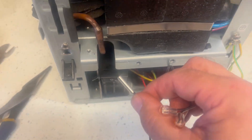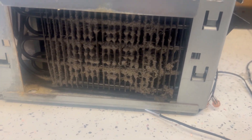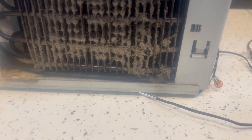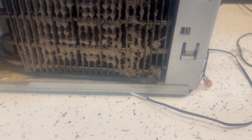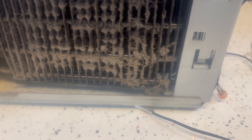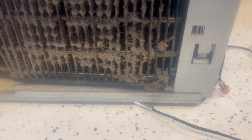While I'm here I just wanted to show you the back of the machine. As you can see the condenser needs cleaning out, because if not this can cause big problems for your cooling issues. All this dust and gunge needs cleaning out — I'll do that later. But I will show you now how to test the temperature sensors.